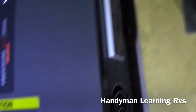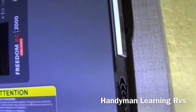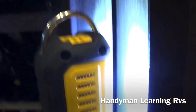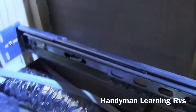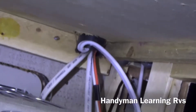On the other side of the inverter I installed the optional GFCI outlet so I can plug my microwave in — this way I can use my microwave while boondocking. Then I ran the 10-2 wire over. The top wire, which is the input to the inverter, goes into the breaker panel box. Then I took some 14-2 wire and ran it from the breaker panel box around and through the galley to the other side.